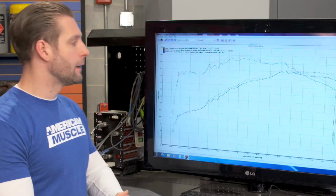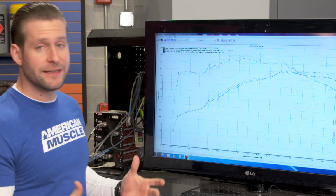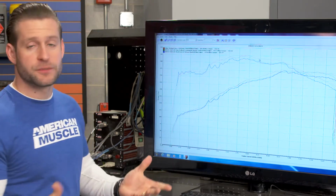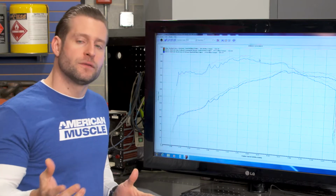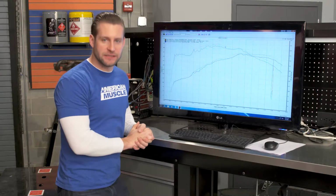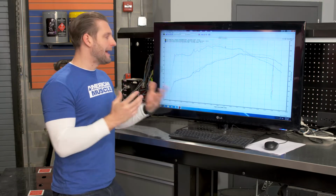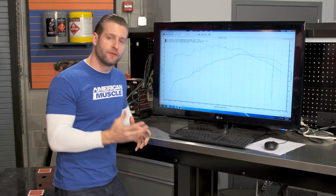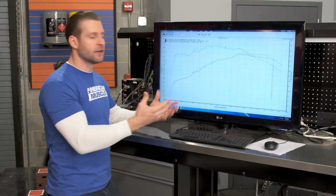all day long. Now, overall, guys, you're probably wondering why these numbers aren't as good as some of your other options here on the site, and the answer is pretty simple. Edge designs their tunes to work for 87 to 91 octane. They don't design a specific 93 octane tune, and as such, they can't be as aggressive with things like ignition timing, for instance, or air-fuel ratio, and again, the numbers suffer because of that.